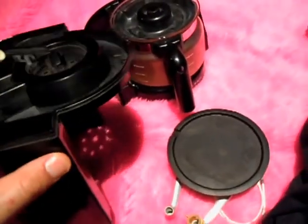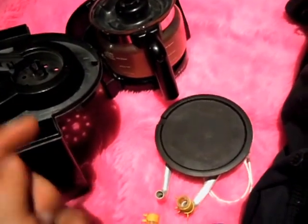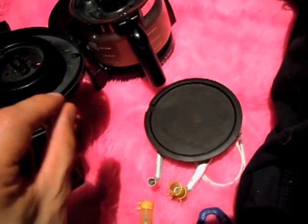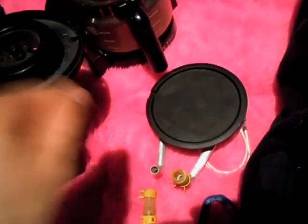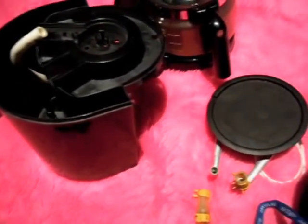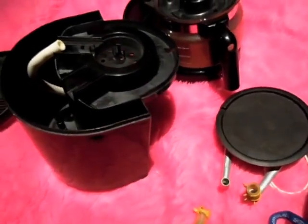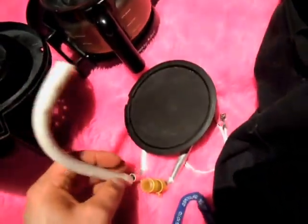That's why coffee makers dump out little packets of water — they go 'blah blah blah,' then stop, then go again. That pulsing is the pressure cycle: the tube fills, heats, forces water out, pressure drops, refills. Valve, heating element, and tube — those are the key ingredients.